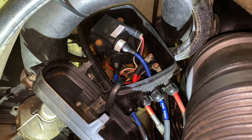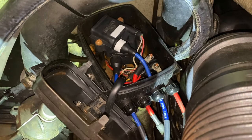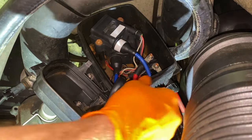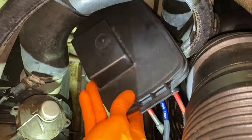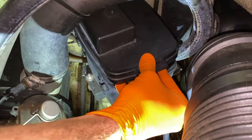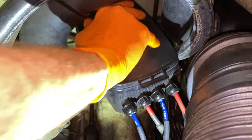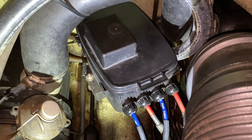Double check everything: both 10mm bolts, both electrical connection points, and both spark plug connection points. Retighten anything that's loose. Now re-secure the cap. Our rubber seal goes on the top portion of the mounted box — the cap has little hooks on either side that slide into their respective slots on the mounted case. Carefully align it and shift it down so that rubber seal creates a watertight seal. As I pushed it in, you heard three clicks — the cap is properly secured.